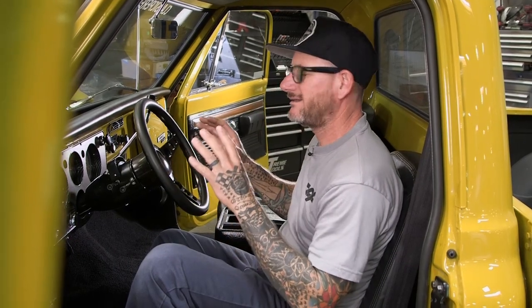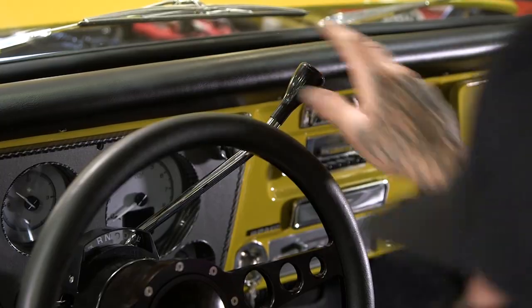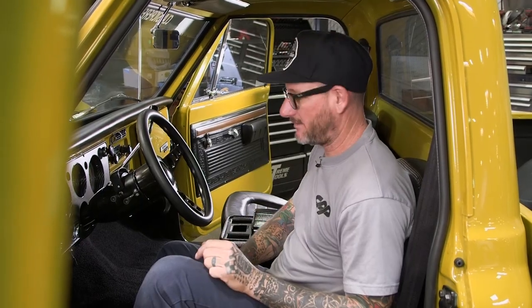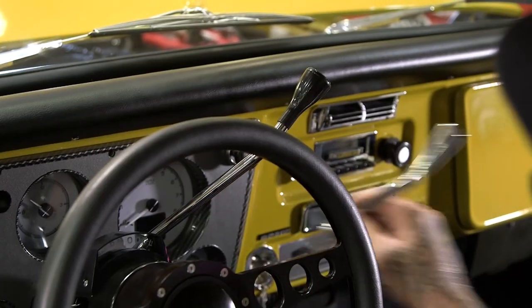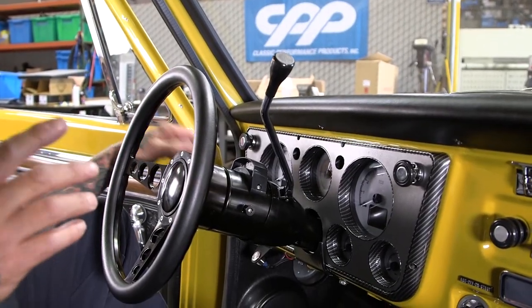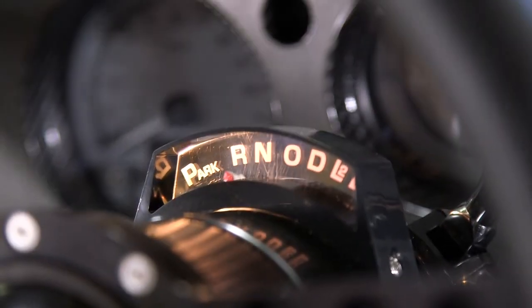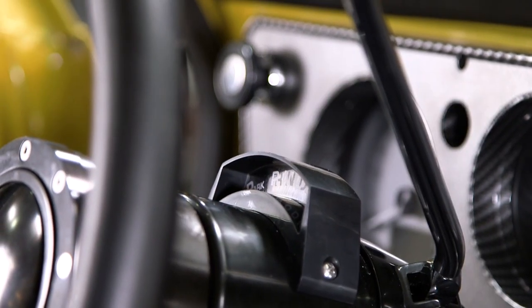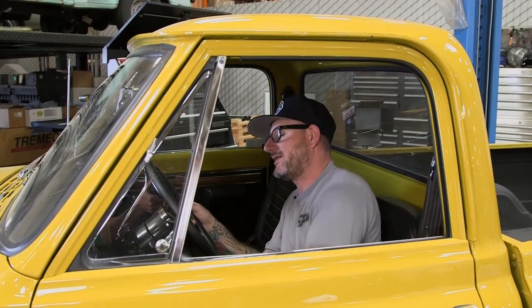Now that I've got the new wheel on there, it's a bit smaller than the stock wheel and I'm noticing the shift lever is about three inches longer. It still looks good, but we've got a shorter one that looks just right, so once I'm 100% on this wheel I'll switch it out. Don't be like me and get through the entire install and forget one thing — one of the benefits of this column is it's got an indicator light so you can see it at night. I went ahead and keyed it to the dimmer switch on the headlights so I can dim it and make it brighter. A couple hours of time, some simple hand tools — we got CPP's premium tilt column installed in this C-10, and boy it feels good. You definitely know the quality is there. All that's left for me is to hit the road.